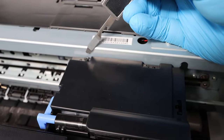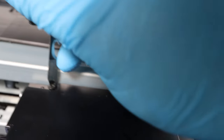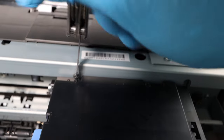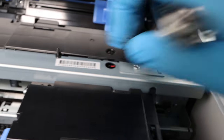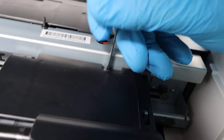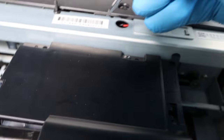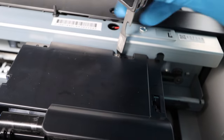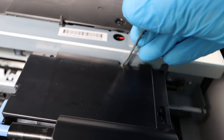Once you have the printhead in the middle — if it's still in the locked position, try printing something. Once the printhead starts moving around, you're going to need to get a hold of it and unplug it. There are two small Phillips head screws. I'm going to be linking a small Phillips head screwdriver in the description below. There's only two of these screws — once you remove them, you will be able to remove the printhead cover. This is one of the harder parts. Once the cover is removed, it's pretty straightforward from here.